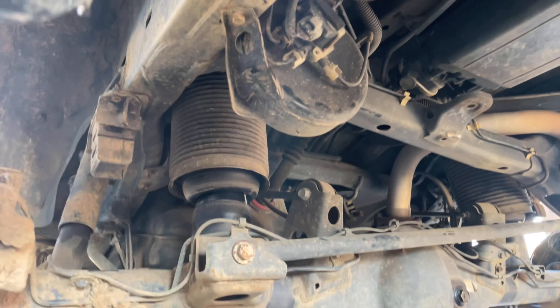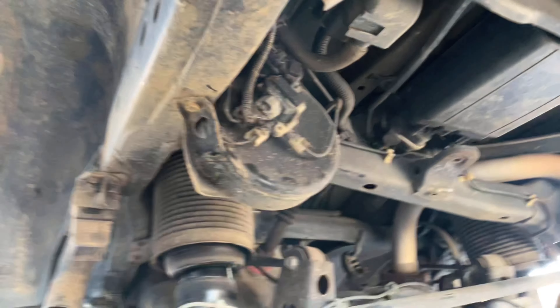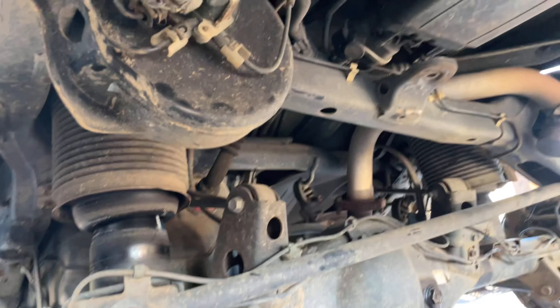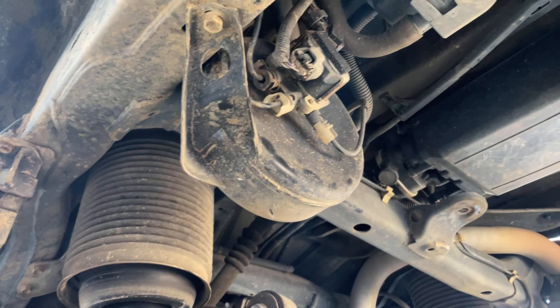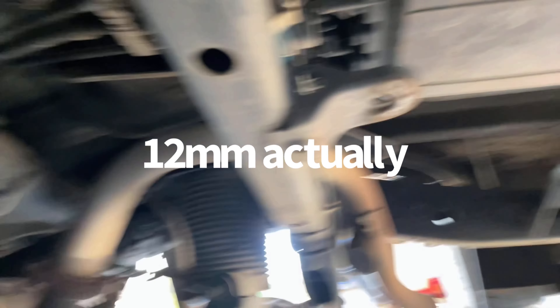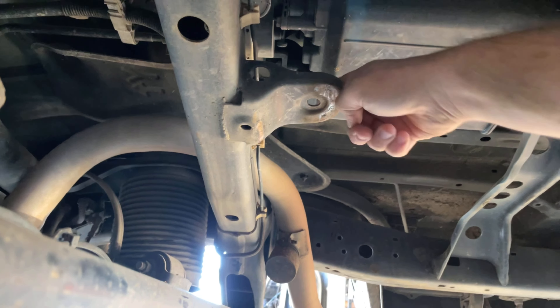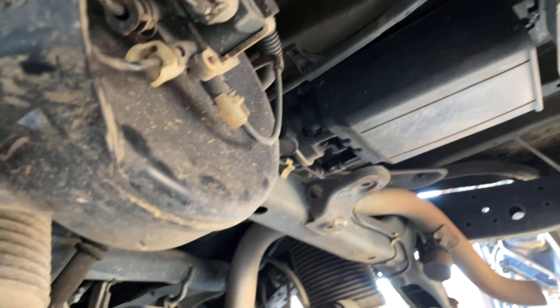So I definitely recommend the impact gun to move things along. At least getting the struts loose will help. So let's get going. First things first: if you've been following me, you know that I've got a video on how to disable your air system. You're going to want to disable that system with your fuses to air — it's not going to continue to fill air in these if somebody accidentally cuts your key on. But this is your air compressor, and these airlines don't have to come loose from here, but they can. And then you've got one, two electrical connectors — 13 millimeter bolt. And you can see where your airlines run: one goes across to your passenger side, and one is going to travel over to the top of this driver's side. I'm going to go ahead and get this compressor out of the way, get all of these off. That's your first step for me.